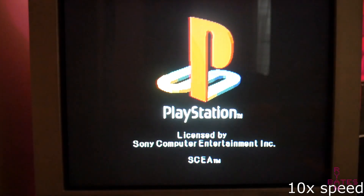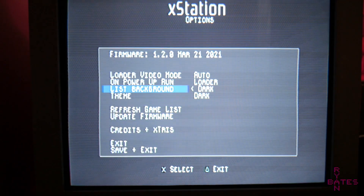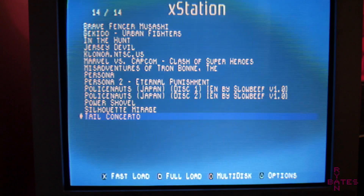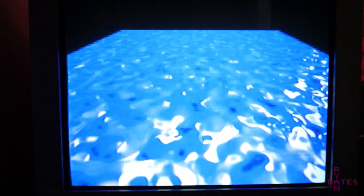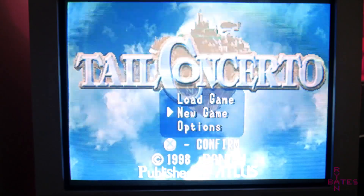You might have to hit refresh to update the games list, and from here you can launch a quick boot — which skips the two startup splash screens — or a normal boot, which loads the disk and goes through the normal boot sequence startup. It will work like a normal PlayStation. The firmware continues to get updates as bugs are found, and the PS1 library is so vast that it's best to keep an eye on new firmware releases in the future.